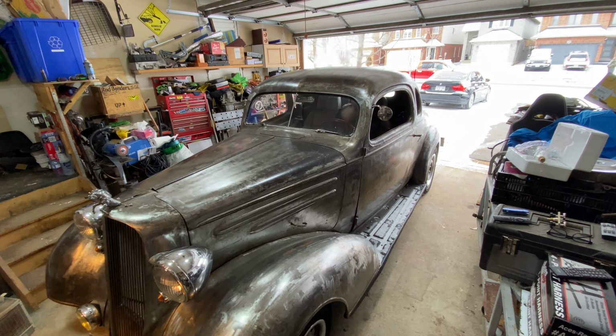Still not there. I'll give you a shout when I've got it. Right, the base of my distributor there is now sitting flush. So I can get my bracket back on, tighten it up. Well, not completely tight enough that I can still spin it. Get the cap on, get all the wires on. See if it works.